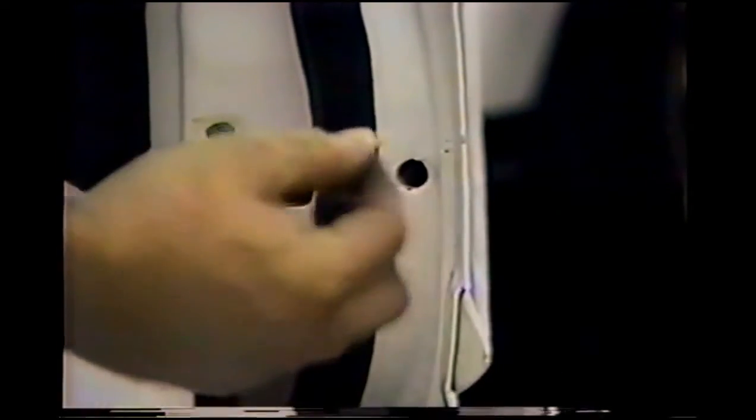Out the third one. This last one, we've come out just a little too far. And so we'll tap it down a little bit and touch up the remainder that's left there on those other two. I finished touching up those dents that I started on earlier. Remember, you use the same techniques. You'll see the light pinching together on the outside. It's the same basic deal.